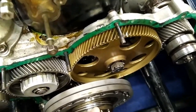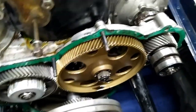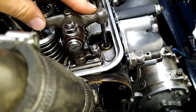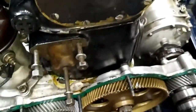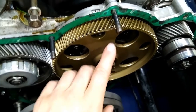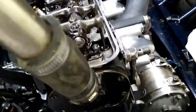What we now do is remove the damper. Once the damper is removed, we move the camshaft gear wheel until we are able to freely spin the push rod on the number one inlet valve. We align this position — and ideally you'd have a wire pointer pointing at one of these gears where you have that valve closing position.